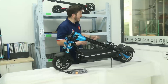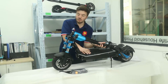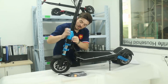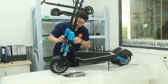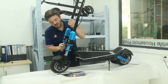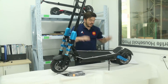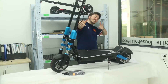Now the final stage after connecting all the connectors together is to place the two tubes. Push each tube all the way in, then use the safety lock, pull down the lever to the maximum, put back the safety, and do the same on the other side. Make a final check with every screw and every detail to be sure it's all screwed tight. Don't forget to charge it for the first ride, and then start to have fun. See you on the road!